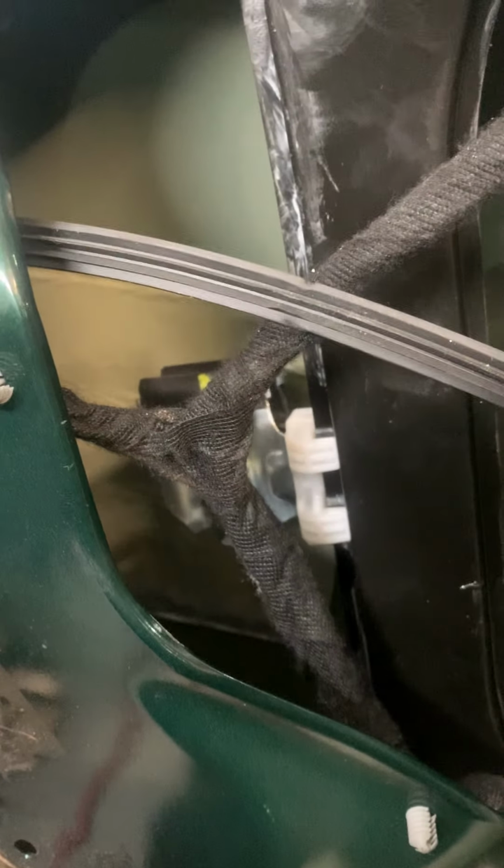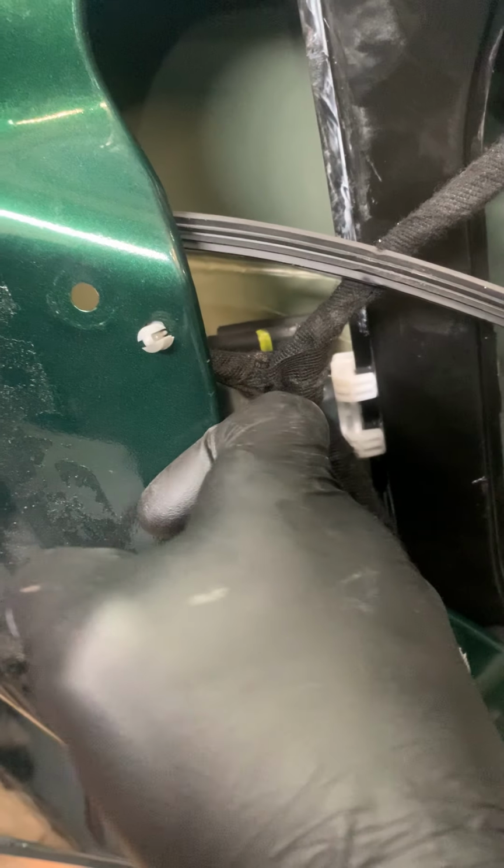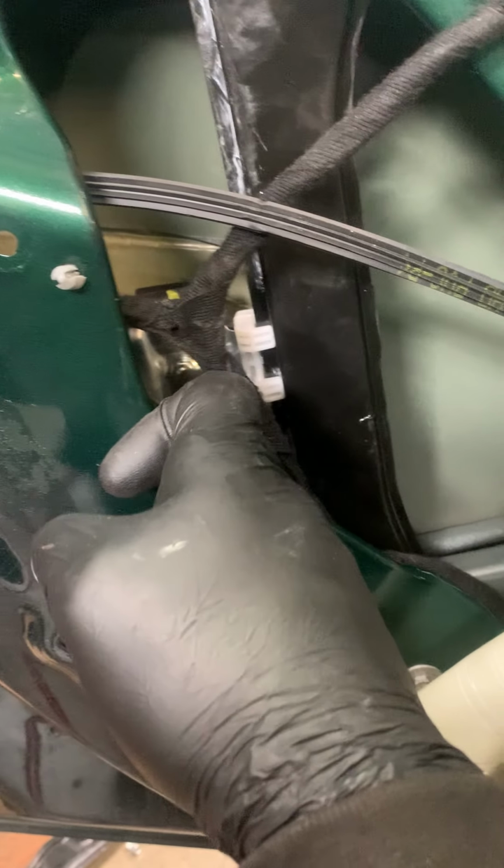Alright, so, see, use the window to move this mechanism again, and I'm just moving it so we can get at it comfortably, straight shot, because we're gonna have to tighten this back up and squeeze the glass around it. Same thing over here. You wanna get it, so like we're gonna probably lower it to right there to tighten that side, so you can actually get in there and work, okay?